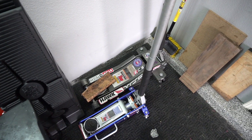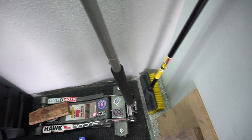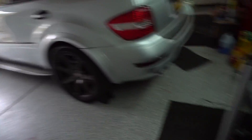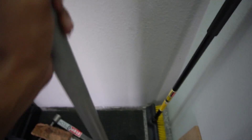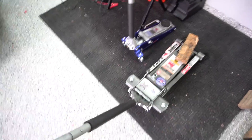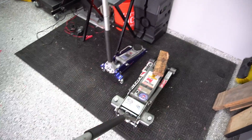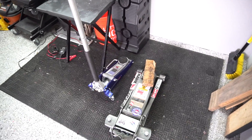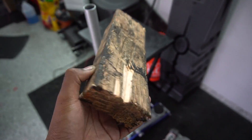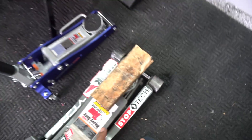If you do work on your car very frequently, I highly recommend using a Harbor Freight jack, just one of these Pittsburgh ones. I have this as a supplement for my lower cars — I jack up a side first, then I can jack up the entire front end. But with the ML, all we need is just a three-ton Pittsburgh jack with the double pump action, which is super nice because one pull raises it up pretty high. I do use a two by four between the jack pad and the car to prevent any damaging or scratching of the undercarriage.